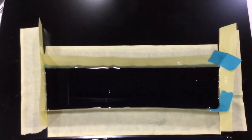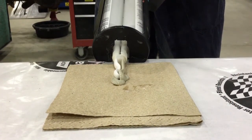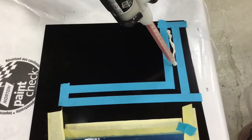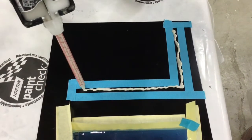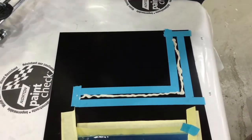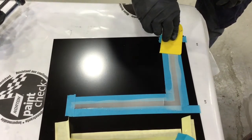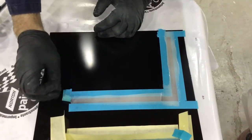Let's go back and look at the purging — you can see the product came out unevenly, which is why we purged before putting the tip on. The next product is a controlled flow seam sealer. I'm applying it to this taped-off section and will spread it smooth with my gloved finger. I'm a big fan of controlled flow seam sealer — it's excellent for replicating many types of OEM seam sealer. It allows the versatility of a thick heavy-bodied seam sealer in that you can work it, brush it, and apply it on vertical surfaces, but it also has some flowing characteristics.